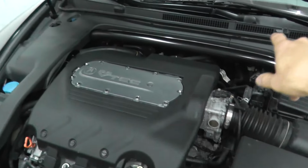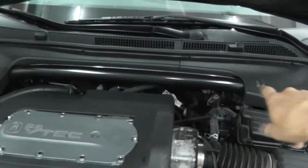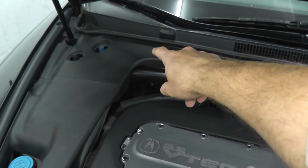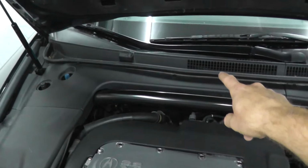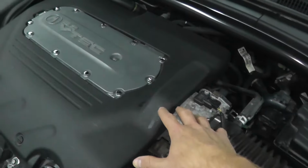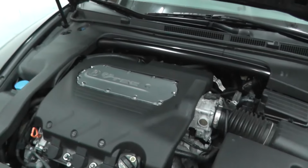In this case, you still have a line, which you'll see in a moment once I remove these plastic pieces. There's a line that runs to the gas pedal. It goes directly to the accelerator pedal position sensor. It takes a reading on what you're doing, sends that to the vehicle's computer, then the computer tells this guy what to do in terms of if you're hitting the accelerator, you're letting off, and so forth. So it's just the way that modern vehicles are.